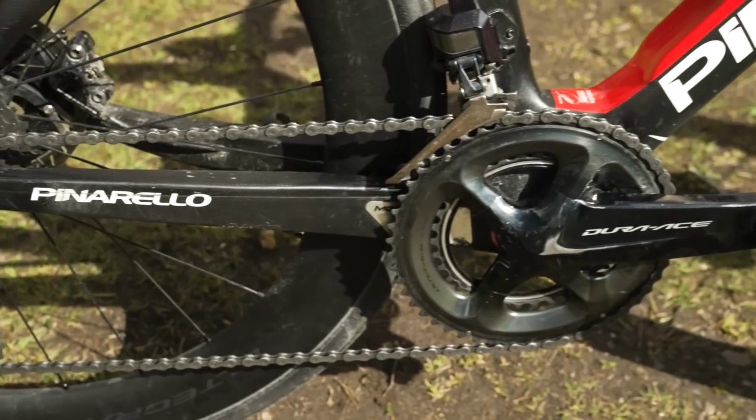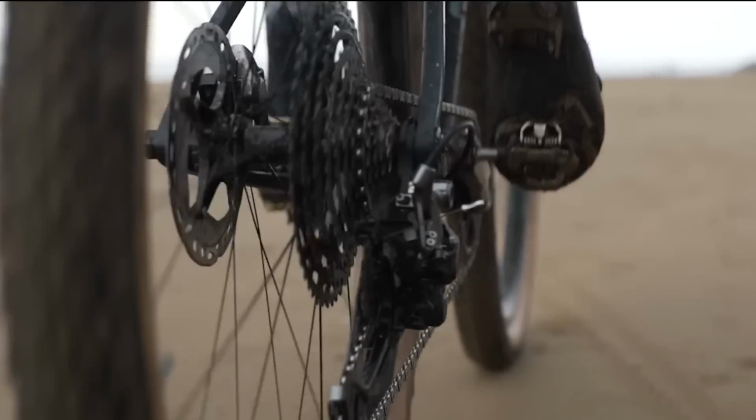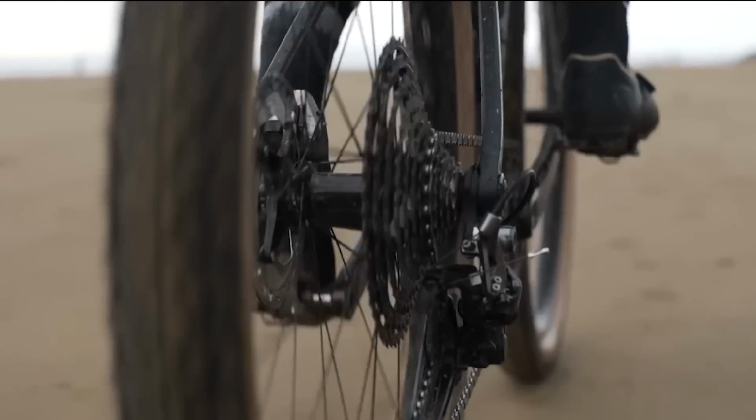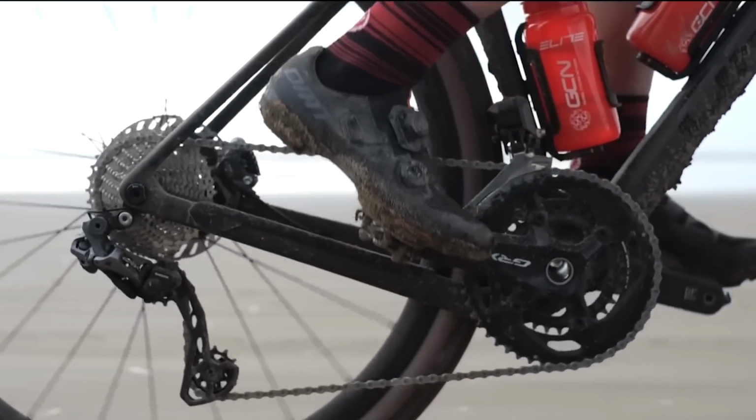Yeah, one of the challenges, especially with the modern geared drivetrain, is you think we're packing, now in some cases 13 speeds into not much more space than we were packing 7 and 8 speeds years ago. And so everything's gotten much narrower, much thinner, including the chain, side plates, and inner plates. But in order to shift, there has to be enough gap and play in the chain that the chain can laterally articulate itself to climb from one cog onto the next cog, and then back down again.